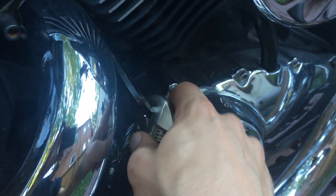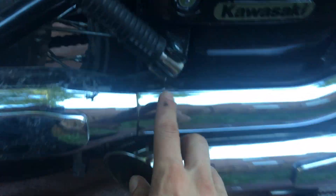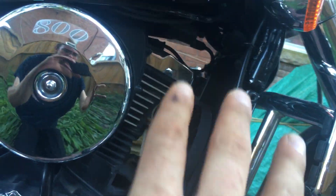This one is fairly easy to break loose; this one, not so much. Here's a little trick — take a wrench and give yourself some extra leverage. This bit looks like a pipe but it is not a pipe, it is a heat shield. It's got a little clamp here you've got to break loose — one there and one there — and then same for the other side. Take off the heat shields first. This bolt was a pain because getting the tool in was hitting the other pipe, so I took the other pipe out. Et voila — both the pipes are off. Look what a clean looking bike is without any exhaust.